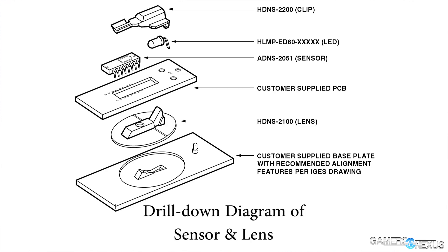Ultimately, as a buyer, you probably want to look at other features in the mouse aside from the DPI number, including the sensor used. In terms of DPI — is that a marketing-heavy number at this point? DPI is literally just sensitivity. 12,000 DPI is just more sensitive than 10,000 DPI — the cursor moves faster. We're not saying you need 12,000 DPI to be more accurate; this is what the sensor is capable of, so we're giving you the ability to access it. We're trying to give people more margin than they need. The sensor can track up to 300 inches per second, and the majority of people will never exceed around 80 inches per second based on our testing.